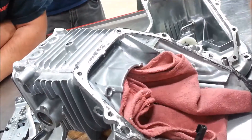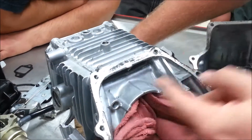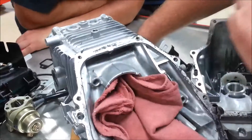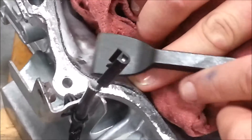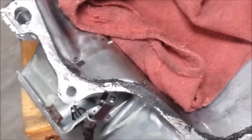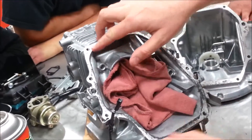The little bit of gasket material left over in the grooves is a great opportunity to learn about machining grooves. When that cutter comes across here, it leaves microscopic grooves that you can't see — and that's what gasket sealer is actually trying to fill. All this excess everywhere is way too much gasket sealer. I have a tip on assembly: how to properly apply sealant so you don't have all that excess spitting out, you get a good seal, and you use the right amount. If I use a ton of sealer and it spills inside the engine, over time that could break off and get into bearings, seals, holes — that's a problem. And when it spews outside, it just looks bad.